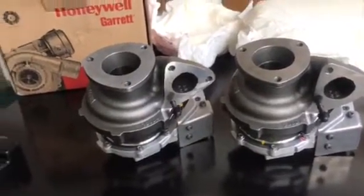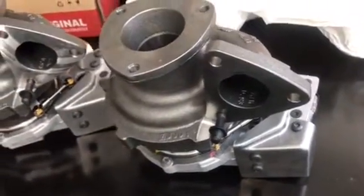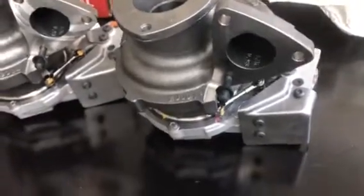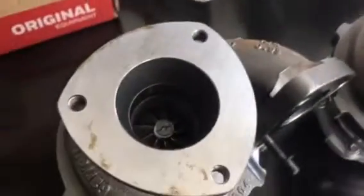So that's basically the breakdown between these turbos. The Powermax has a revised turbine wheel, turbine housing, and turbine housing material, as well as a revised compressor wheel. Everything else remains bolt-on — all the flange faces are the same and everything is supplied with gaskets.